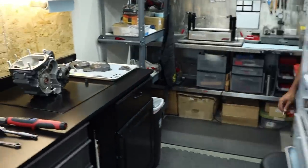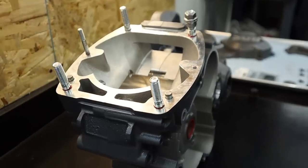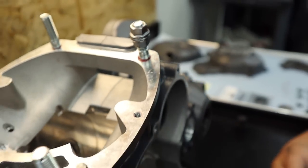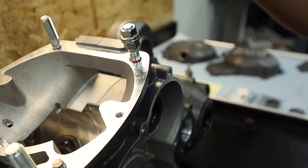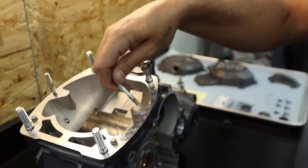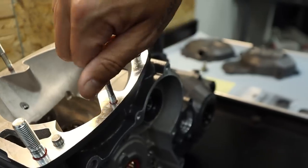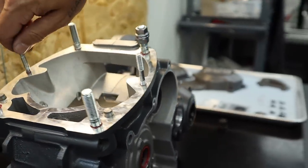So what you got going over here? You did some Uncle Tony prep while Charles was in the tank cleaning parts. So I got the cylinder studs in. I just dry ran the cases together, just so it's easier to manage when you're torquing parts and I'm not cutting my hands or anything. On the gasket surfaces, got a little bit of Maxima assembly grease. Oh, there's Maxima again. Give us a call. This is by choice, folks.